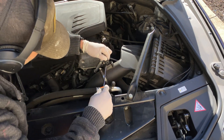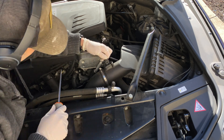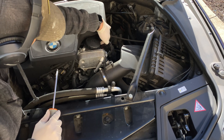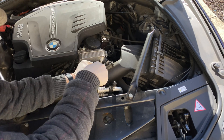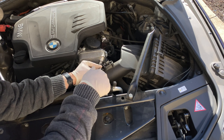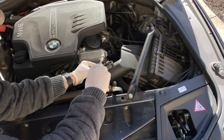You don't need to remove the air box, but it will make things a lot easier. The first thing I'm doing is removing this sensor, carefully setting it aside, and then we're going to work on removing this hose clamp with a regular screwdriver or a small socket. You don't need to take it off completely — just loosen it enough.